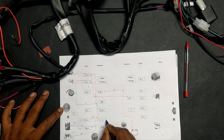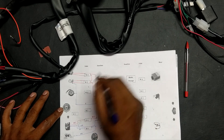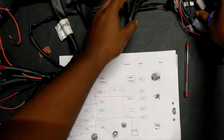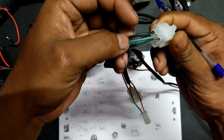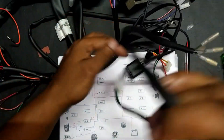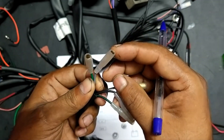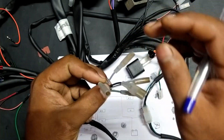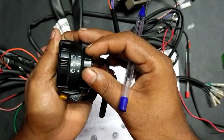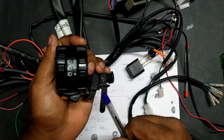Again from this junction, the line moves through the wire sleeve and reaches the white-five junction. From here it reaches the back end, which is used to trigger the tail lamp. Here in this part the tail lamp gets connected. Therefore when we make the switch to the pilot lamp position, the speedometer backlight and tail lamp get enabled.